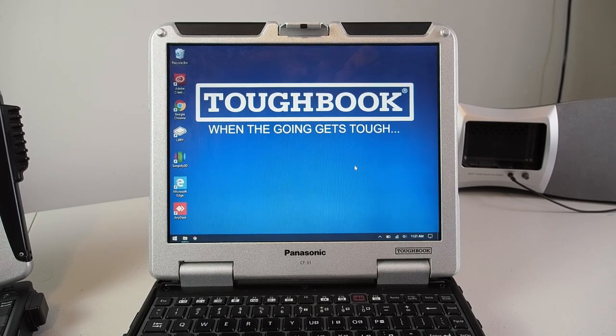It does thermal throttle a little bit when it's under full load, so yeah, it does hit that like 100 degrees Celsius mark and stay there when it's under full load. It still performs just fine, but if you're worried about high temperatures affecting the lifespan of the processor, it might be worth looking into doing some sort of mod like that, either replacing the thermal pads with more effective ones or doing something like a copper shim.